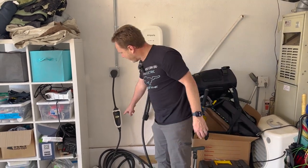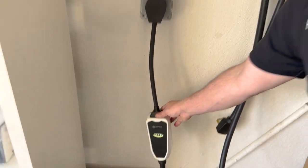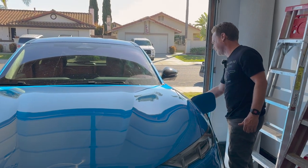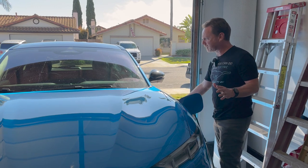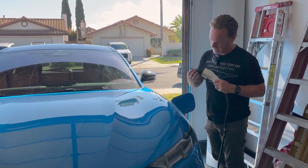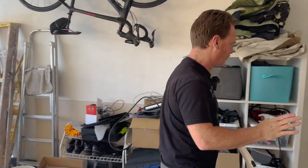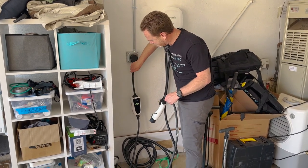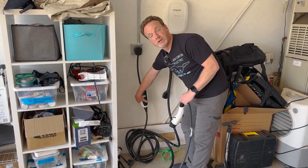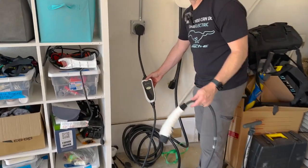We just hit an hour. The lights are still going — it's doing what they call marquee, cycling one after the other, which means it's charging. Good news is we got 19 miles of range in the past hour on the 32-amp charger. I've touched the cable all over while it was charging — nothing's warm. This little bit of cable is slightly warmer than ambient, and the unit itself is a little bit warm, but nothing very hot. Now it's showing three green lights, indicating it's ready to charge again.